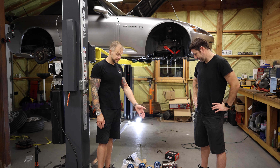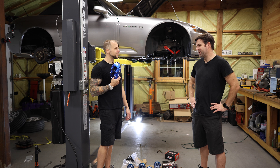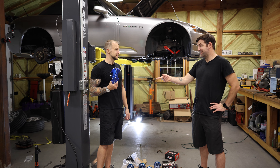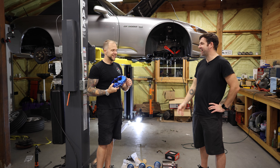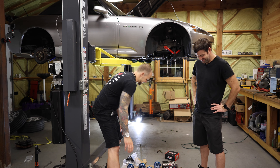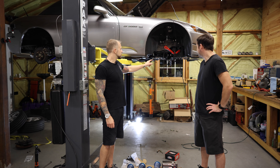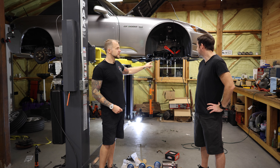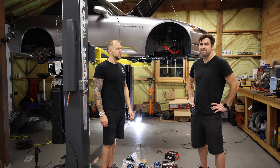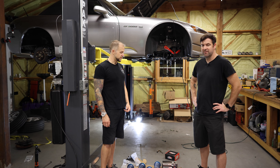And then we're getting five pounds per caliper. Oh my God, right? So awesome. Just in suspension upgrades, that's over 20 pounds of weight savings. And that's definitely unsprung weight — whereas the shocks, I don't know how you calculate that. We are adding a little bit of weight with the spacers and the bigger ball joints in the rear. But it's still not adding more than a pound and a half. You're still at a significant at-least-20-pound weight savings.